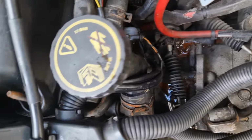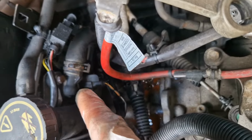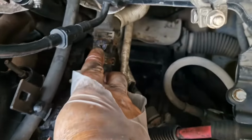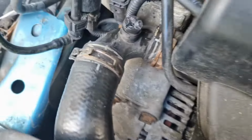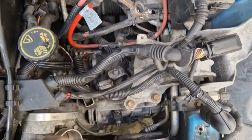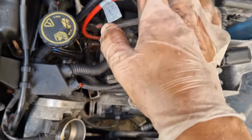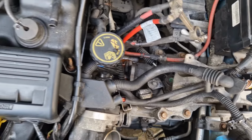So we've got all that screwed back together, 3 screw bolts gone back in, that one below it and one over that side. I've swapped the bleed valves over. That one's not that good, but it's better than the one that was there. So we've got the horrible one there. At least I can use a pair of pliers to undo it. That's just a matter of reassembling. So I need to put the airbox in first. Once the airbox is in, then I can put the battery compartment back, and then put the battery in. Then fill the engine up with coolant.